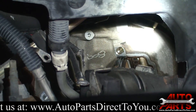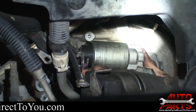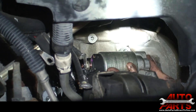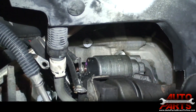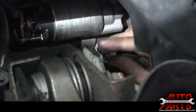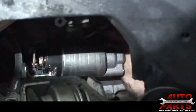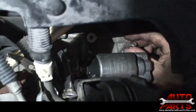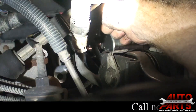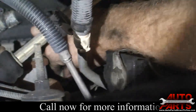Now all we have to do is guide our new starter back up in there. This one has some guide pins that line it back up directly with the factory holes, and it also holds the thing in place while you get the bolts started, so it makes it a little easier. We've got the starter lined up — we're going to get one of these bolts started in the hole here, just tighten it down by finger for now, then get the other one. Before we tighten those down, we're going to make sure everything looks like it's lined up correctly and make sure none of the wires are pinched behind it. You can see the three cables are all free, so we haven't pinched them. We're going to get this last bolt started by hand.